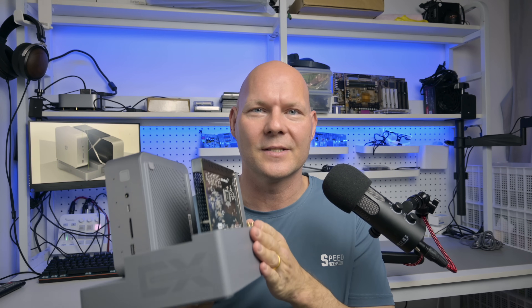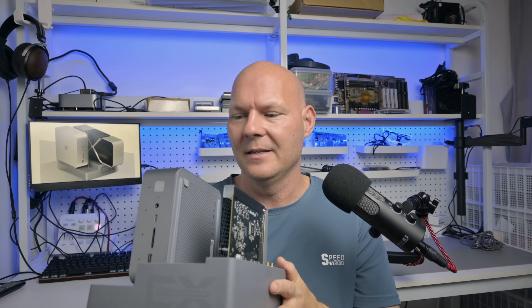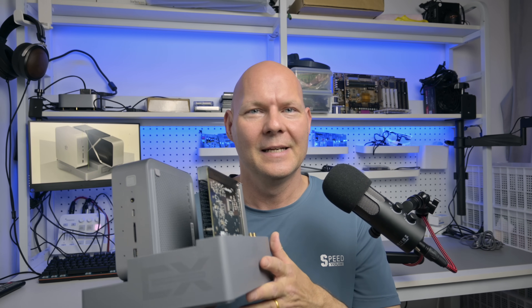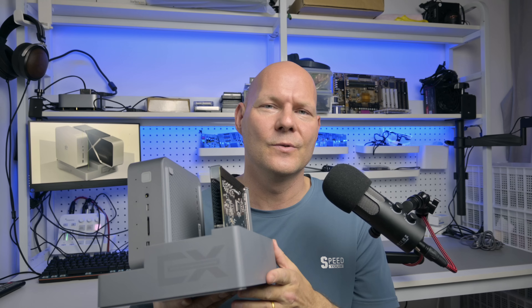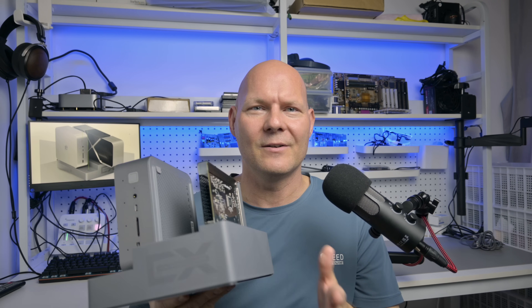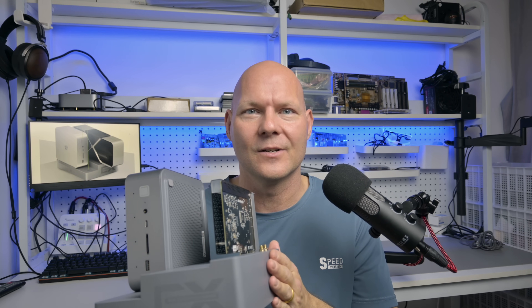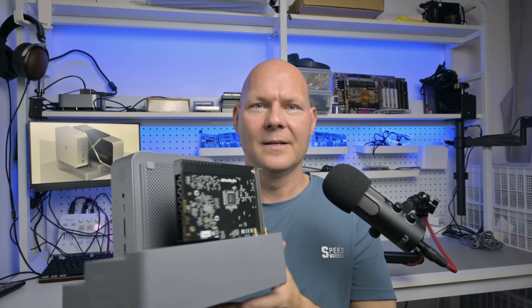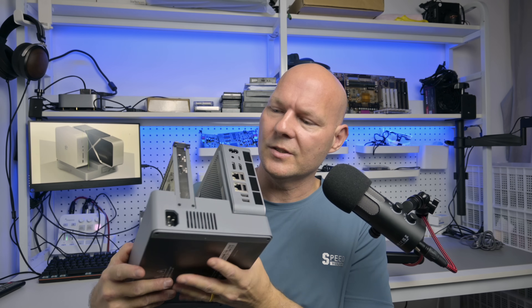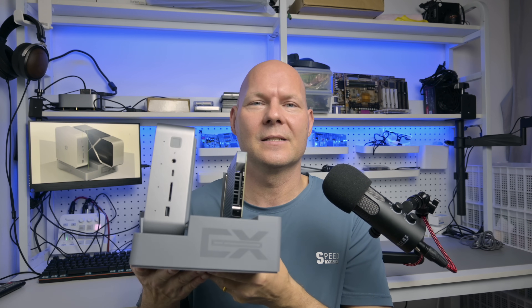I think this is a really interesting concept. I've been using mini PCs for quite some time and they always have a really decent CPU but fall short on the graphics side. The latest AMD mini PCs have some decent graphics power, but against a dedicated GPU it's still quite slow. What's nice here is that a lot of eGPU solutions you can buy aren't certified — there's no guarantee they work and performance can be limited, for example only four PCI Express lanes. This one has eight, and they are of the 4.0 standard, so most high-end video cards will have no issue being fully utilized. It's also very neat that the power supplies are integrated in both units, so you just need the cables — no power bricks. It's a really nice, neat, minimalistic setup.